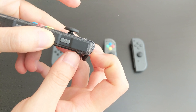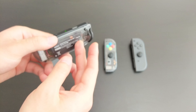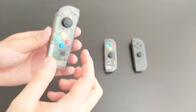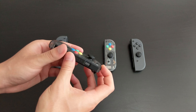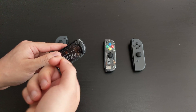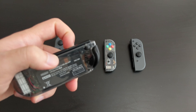You can see that this part has some thread — that's because that's where the screw went in — but the part below it has no thread because the case itself didn't have any thread in the hole. So just bear that in mind when you put it in, you have to use some force. The case replacements also came with some replacement screws, but I would probably avoid those because I've heard horror stories of people breaking the screws as they screw in, since you need to use a lot of force because you are cutting the thread as you go. So I stuck with the original black ones.